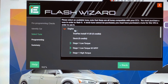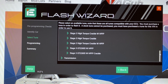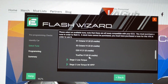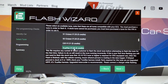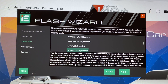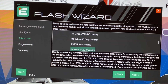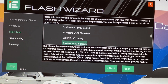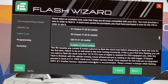We're going to check over on the engine. Not everyone will have this file, but if you're switching over to the Stage 1 TruFlex tune, go into the Stage 1 high torque with high pressure fuel pump option and hit TruFlex. Make sure you read the notes at the bottom of these tunes — they're really helpful. This one says it requires the customer to flash to stock before attempting this tune, and failure to do so results in the tune running incorrectly. It also says if this is your first time flashing you will not need to flash stock first. There's also a note that TCU tune 2.10 or higher is required for DSG-equipped cars. After the flash, ensure ethanol percentage is reading in the data logger — if it's stuck at zero or 100, check the TruFlex harness install.